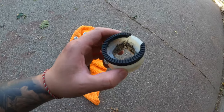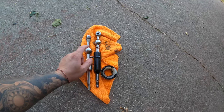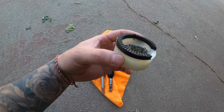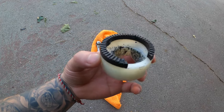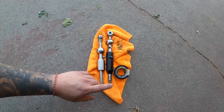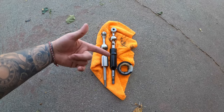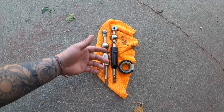Since I couldn't get this off, I just broke all that off and now I got it off so I can easily put the new one on. But what I recommend before you start this project is to buy a new one online — this is called a shifter socket coupling. Make sure you order this before you do this project at all. Do not do what I'm doing. I'm going to install this and see how it goes, and at the end I'll talk about it and see what happens.